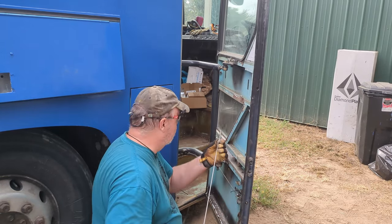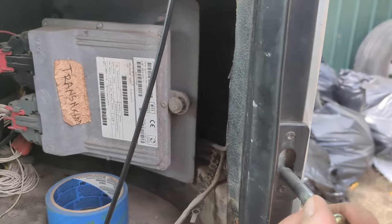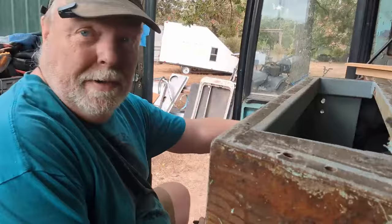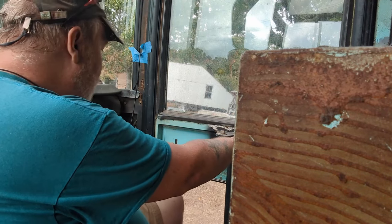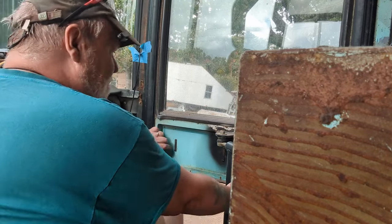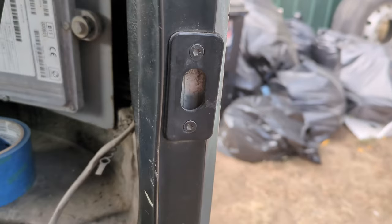Do not lose that. So that's the door closed — I can put a little bit of pressure on it to pull it in, but I don't want to be yanking on it just to get this pin through this hole and into the receiver on the outside. I'm yanking on it pretty good and it's still not going in. I need this to slide in nice and smooth. I'm going to put tape over the receiver and figure out where the pin is hitting, then remove some material there.